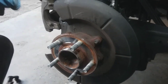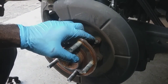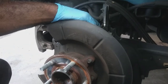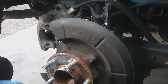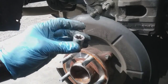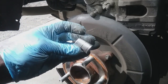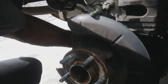I got the bolts exposed. Here we can see the head of them. We're going to go through the back of the spindle here and loosen up all four of these bolts so we'll be able to remove the hub assembly. The back is going to use an inverted bit — it's a star bit, an E16. I'll need the necessary extensions.